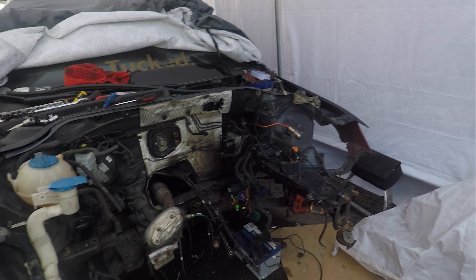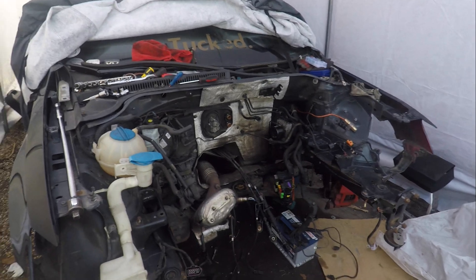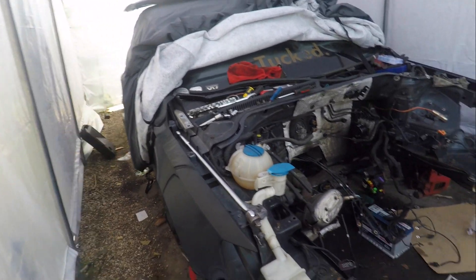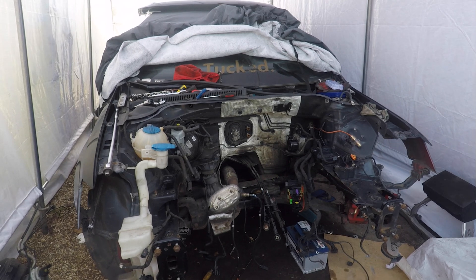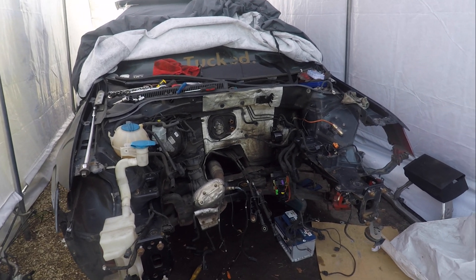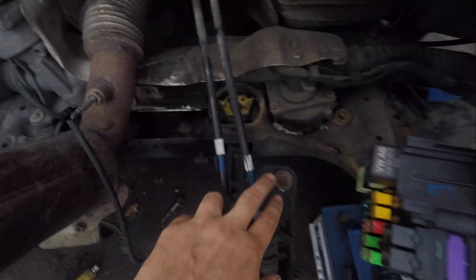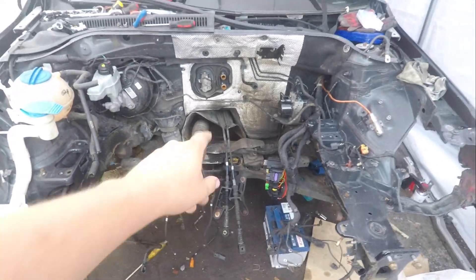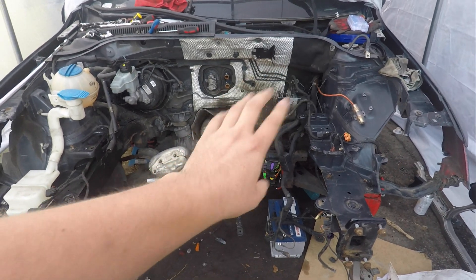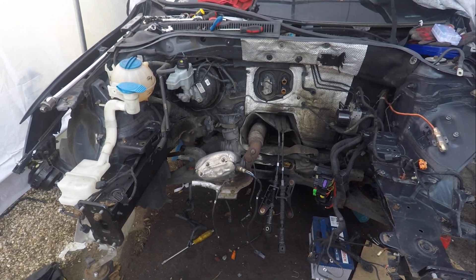What I'll probably do is try and mock the engine up in the engine bay just to confirm it all fits — I've got no worries there. Then I'll make a start on the back of the car. I've got all the rear subframe stuff ready. Ideally I need to polybush everything. The front subframe is done. The only one left is this one — I found a full polybush replacement online. The lower arms are done already, so I don't really need to change those.